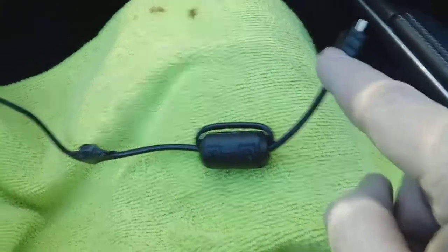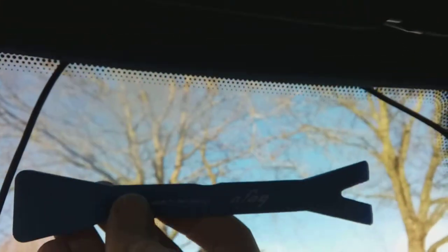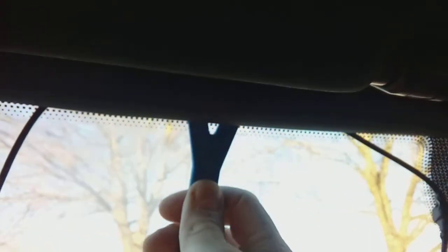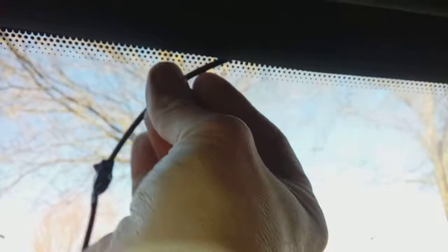Start in the middle. The headlining on these vehicles is very tight. If you can't get your fingers under the edge to pull it, use a plastic leverage tool such as a pry tool or plastic scraper and just pop it under and pull it down slightly. Do not be tempted to use anything metal — you could damage the headlining or even crack the windscreen. Just pull it gently enough to create a small gap to shove your sticky tape and cable tie lugs under so it all sits flush.